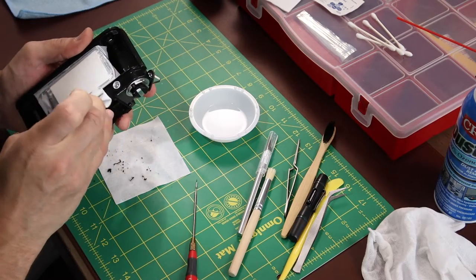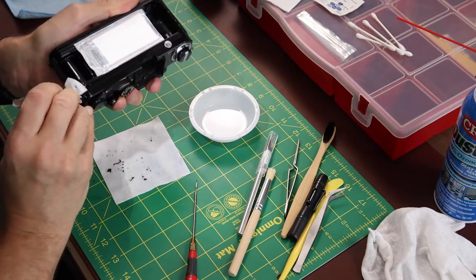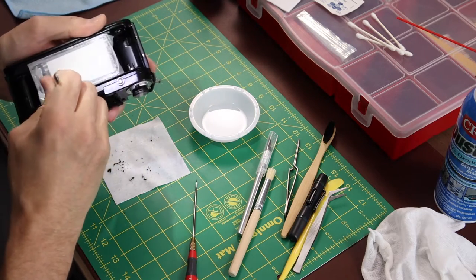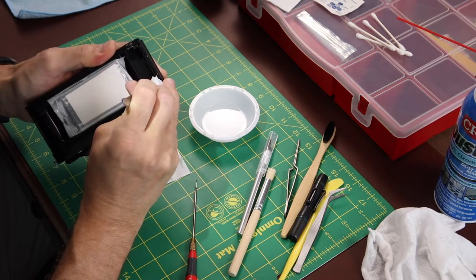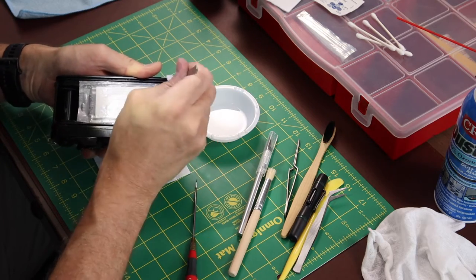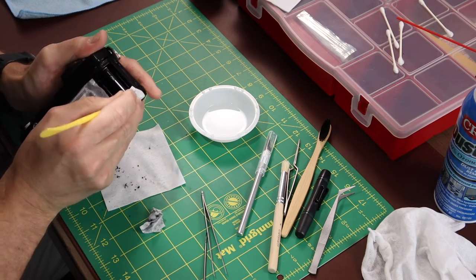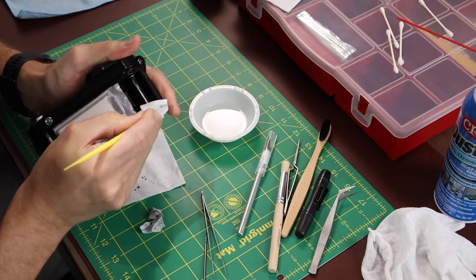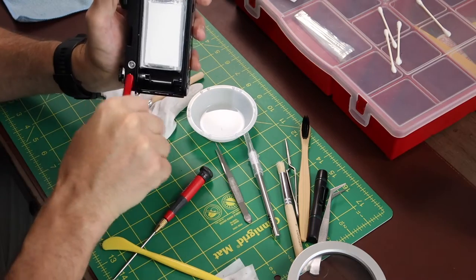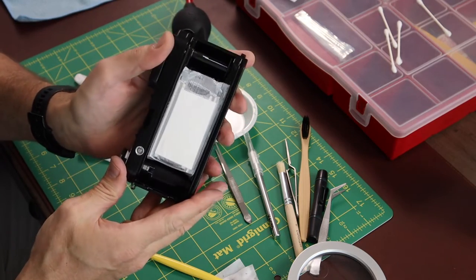You're going to use a fair amount of alcohol in this. These little alcohol pads — with tweezers to manipulate them throughout the camera — made the job a lot easier. You could use PEC pads dipped in alcohol, but Q-tips are just too big to get down in here. These alcohol pads, especially with the plastic tools, are really good for scrubbing that old seal out, because those old seals are just sticky and nasty in these old cameras.